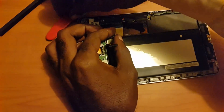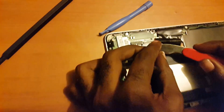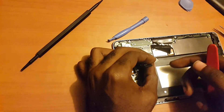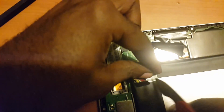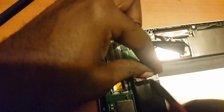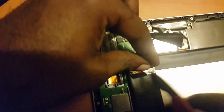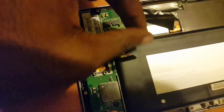This connector will come right off — in some cases it will be larger or smaller. What you want to do is get a blunt object like this one and find the contacts — the part that actually contacts with the motherboard. Look very carefully, then use the blunt object to gently rub or lightly scratch the contacts. By lightly scratching them, you're removing the corrosion that exists on these contacts. It's actually a lack of contact that's preventing the tablet from working, so you're re-exposing them by scratching off any corrosion. Yours might be larger or small like mine.